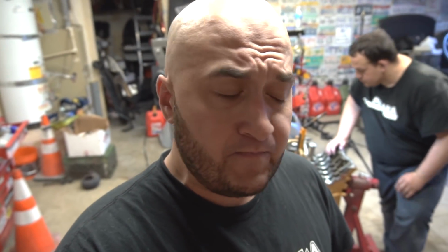What's up, Malaka? So I kind of messed up. I was removing the bolts, and I ended up using a T27 instead of a T30, which I thought was a 27. And I stripped one of the bolts. So I'll show you guys in a second. This is going to put a halt to this process. We're going to hopefully go get an extractor set and then take it out.